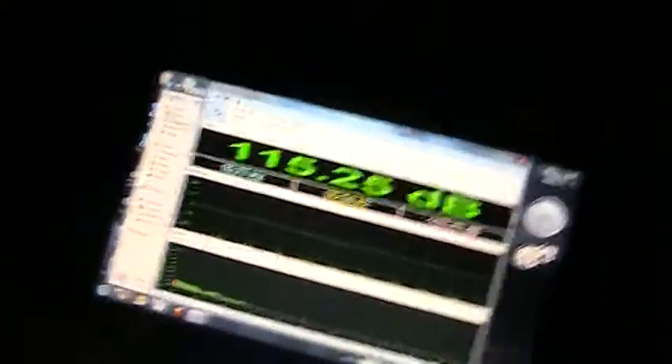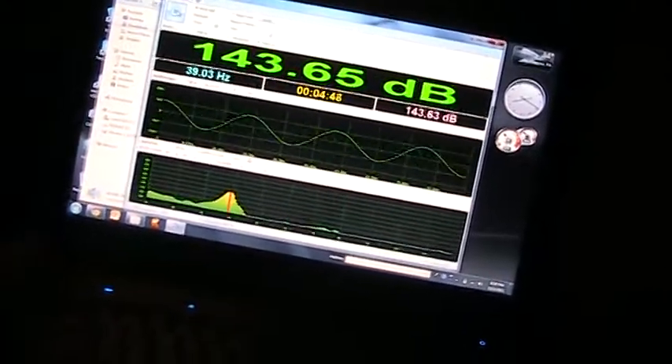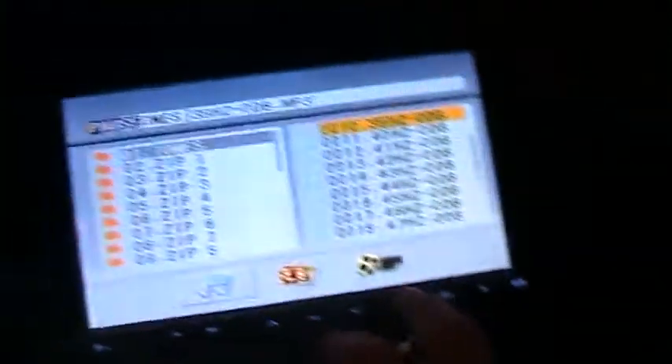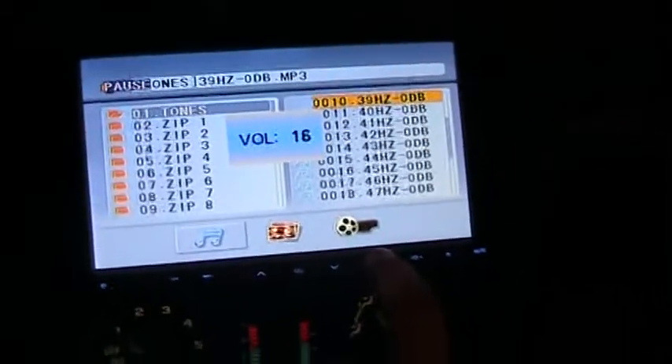Just because I want to — I'm bored. Alright, we'll try it again. Volume and bass knob are up. Let's see if I can grab a higher reading. At least I was louder than I was before. I just need to find a way to keep those volts up. It should help when I get my other batteries in, but right now it's just one Group 31 in the back and one Group 34 up front.